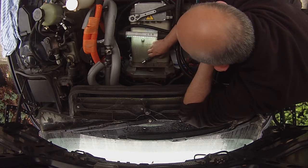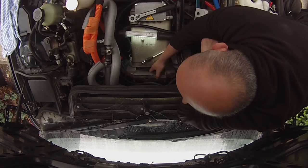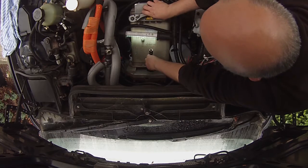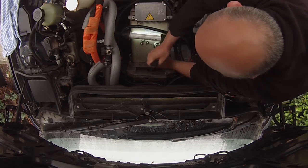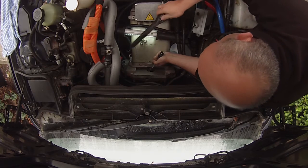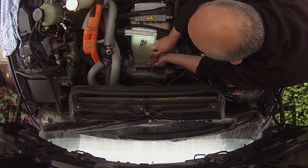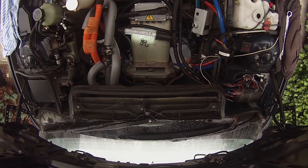Push the first one out. I'm going to rotate around, just with my fingers, moving the flex plate around until we get to the next one, and keep on doing this until we get all four out. There we are guys — all four torque converter bolts out.